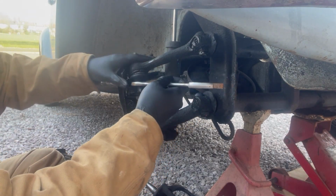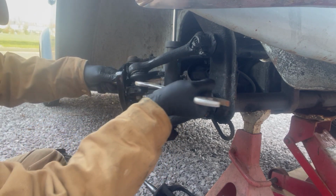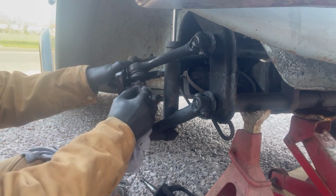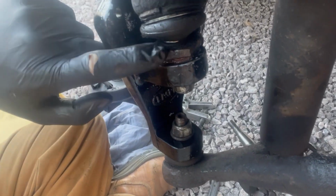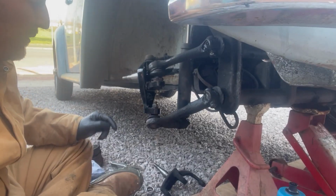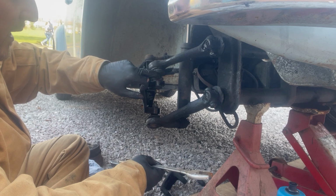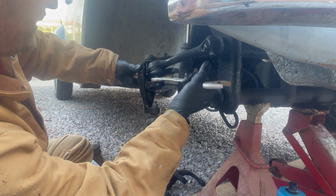So basically, what you want to do is, before you tighten this up, you spin this around, and what you're looking for is this notch. So I'll give it a little bit of a wipe. Maybe you can see there's a notch, and that notch basically should be at the front. So the tricky thing is that's basically what VW recommend as the starting point to set up the camber. So, you know, if everything's working well, everything's okay with the beam, then that should be the camber setup.